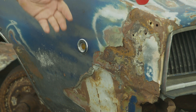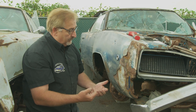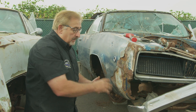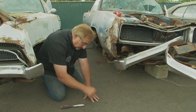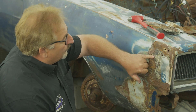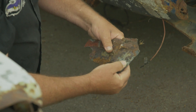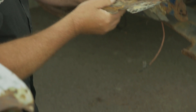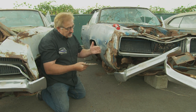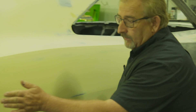That's what the fender looked like when the body man was done. This should have never had filler put over it — the fender should have either been replaced or at least repaired right. A body man could have cut this section off, put it upside down on a flat area, beat the backside out, shaped it right, and welded it back up. Instead, they kind of got it roughed out and smeared plastic filler over it — over these holes. Imagine these holes exposed to the elements on the backside. Every time it rains, water goes up; this stuff absorbs, it's just plastic, it'll absorb water, and when it does it swells, it forms rust, and that's what you have. This is a textbook example exactly why filler has a bad name.